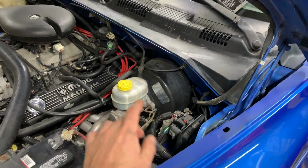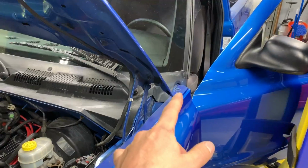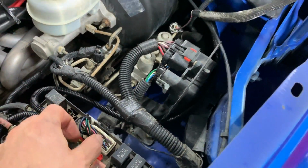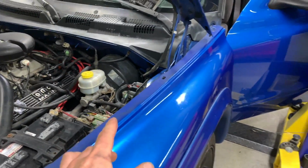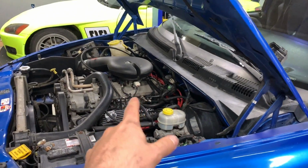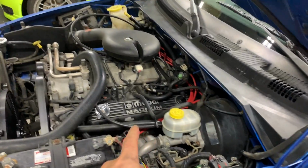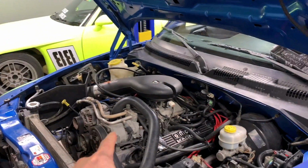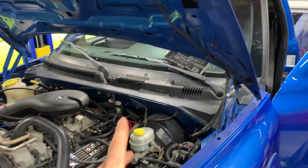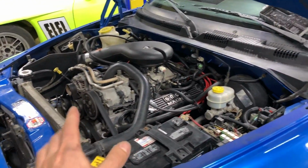So we did end up switching our switched ignition power to a fuse from under the dash there. Because I had before tapped into one of these wires that we kind of used as a test light or meter to find switched ignition power, a lot of those are running to different sensors on the engine, and it can kind of do some weird stuff. So the wire we ended up tapping it into, coincidentally, was somehow in line with the AC compressor. And if you turned the AC on or off in the vehicle, even though it had switched power, the voltage would change and it would affect the cooling fan.